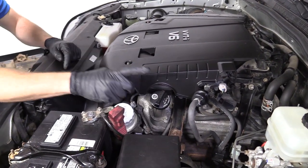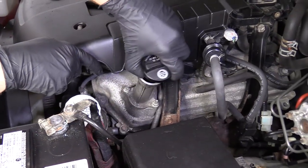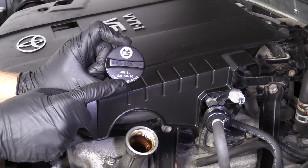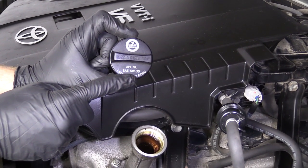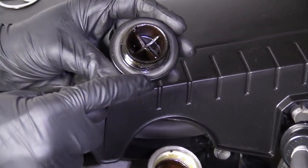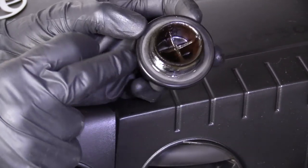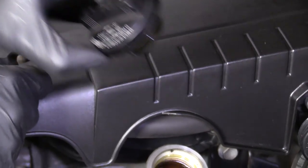So now that we're under the hood, you can see where your oil fill is. Take off your cap. It says specifically right on it what type of fluid to use — 5W30. That's what the manufacturer wants you to use, so that's what I would use. Turn over your cap and make sure your seal's good. If it looks swollen or dry and cracked, you'd want to replace your oil cap. This one looks good.